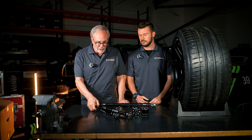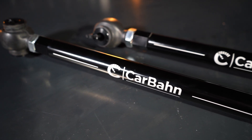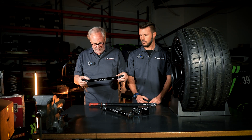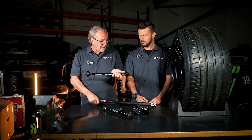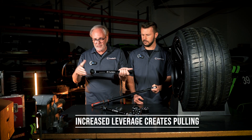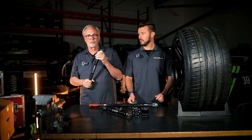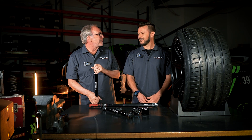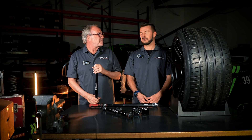On the rear of the car you have what are called toe links. These are for adjusting the toe, but they also add stability to the suspension system. From the OEM they have rubber bushings on the end, and sometimes even have a curve in them — the arm itself flexes a little bit. When you have this extra leverage, the rubber bushing compresses and the rear toe changes on the car. It honestly feels like someone's in the trunk with a steering wheel driving the car with you. The rear car squirms quite a bit — it's a dynamic toe of the OEM suspension geometry.